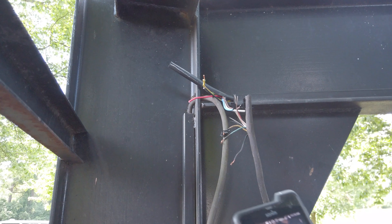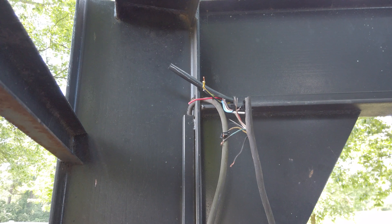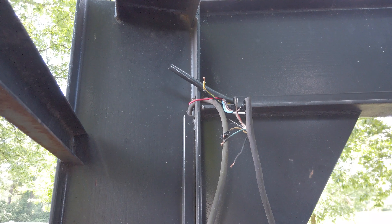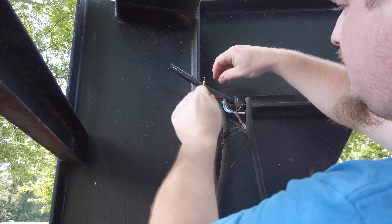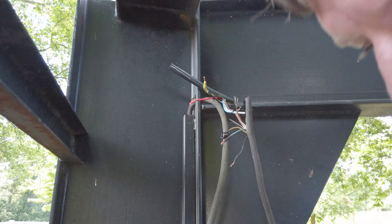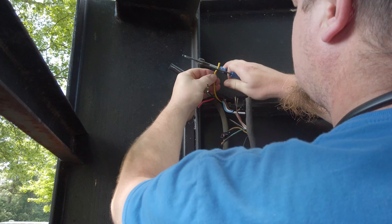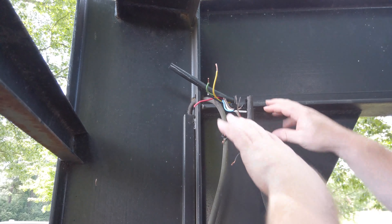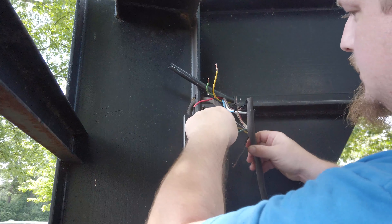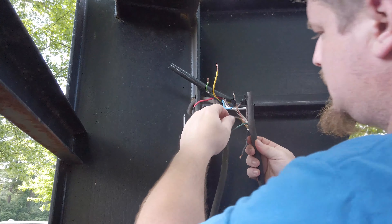For the last step of testing, I took a picture yesterday of the different wire colors — there are only two that are off, and that's for my right turn signal and my brake control. But other than that the colors all line up. What I'm going to do now is hook those up, make sure that everything is 100% the way I want it as far as turn signals go, and then after that I'm going to solder all these connections and make it nice and neat to get into this protective tubing.